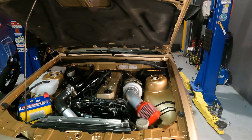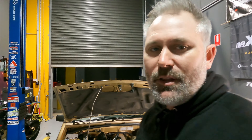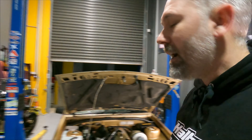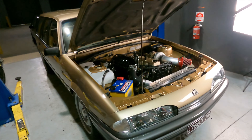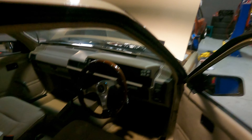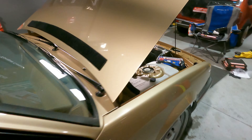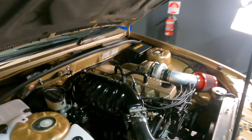Then I had an issue with some fittings on the trans cooler, which I've now replaced. And then one more issue — the oil feed line for the turbo. An error of mine: when I pushed together and tightened up that fitting, it probably wasn't tight enough and it popped out, causing a little drip leak. Nothing major, didn't cause any issues with the engine. I've also added more Raceworks heat sheathing on the new line and routed it differently. Before I had it tucked coming up between the runners, but there was a bit too much heat. So I've gone the other way — giving it more slack, running straight out from the block with a straight fitting to a 90-degree, away from the heat and better insulated.